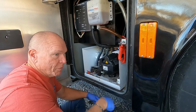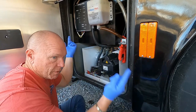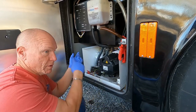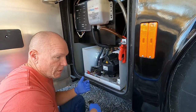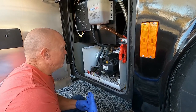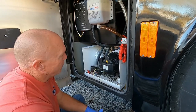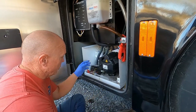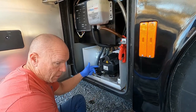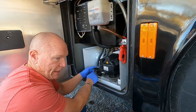Running down the road, it heats the boiler tank and fluid up. So you just turn on the thermostats and they start the pumps, running antifreeze through the different registers and heating up your coach. So it's sophisticated in all the different things it does, but it's simplistic and mechanical — fairly simple to work on and diagnose. You can pull the electrodes off the pumps — if the pump's not running, put 12 volts to it and it'll either run or won't run.